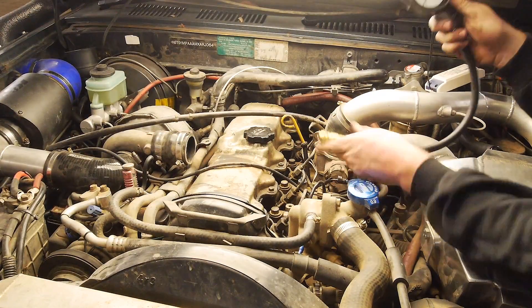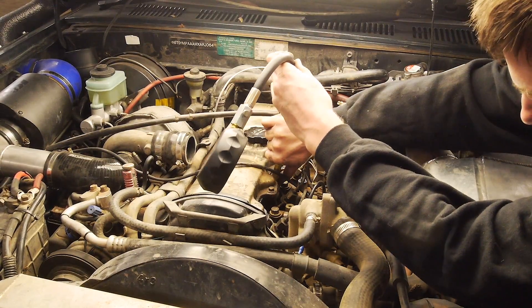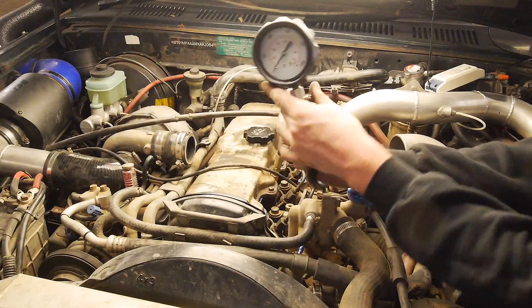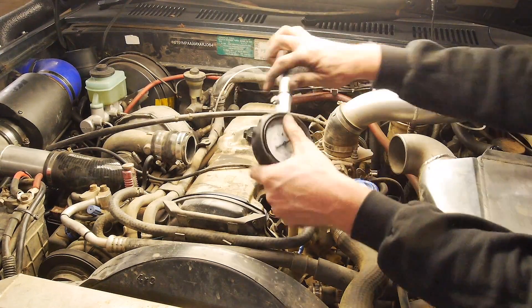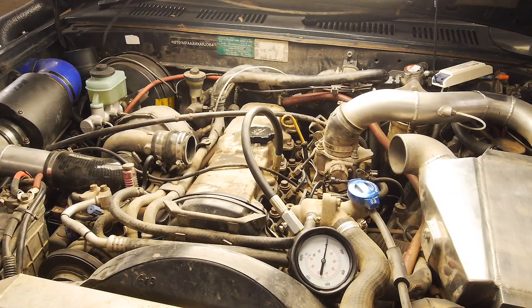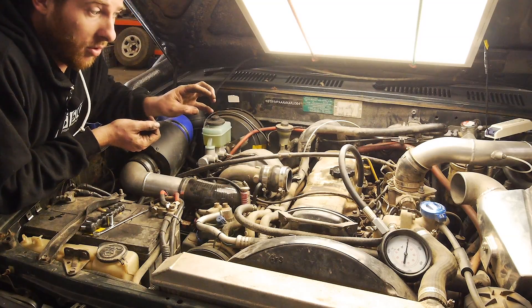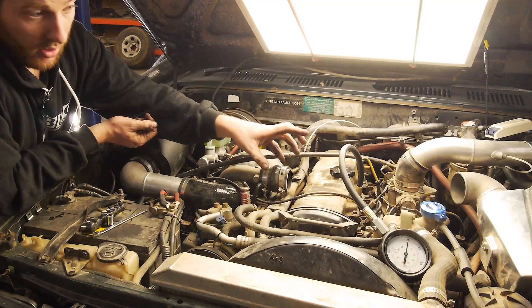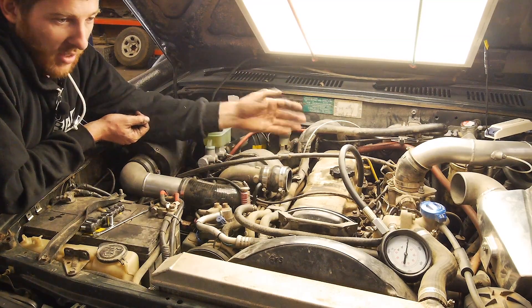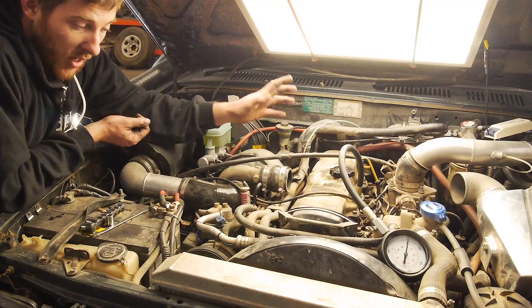So next up, get your gauge — the quick connect coupler will go down, you may have to hold your thumb to lift that tang up, then it will just push in and click on. Nice big gauge — it's actually really good quality. All glow plugs are out, the fuel shutoff solenoid is disconnected so we're not going to be pumping diesel. The gauge is hooked up. I'll start from back to front — I've got a list on my phone going. As I said, I've already done it and it's already looking good, but I'll run you guys through this.